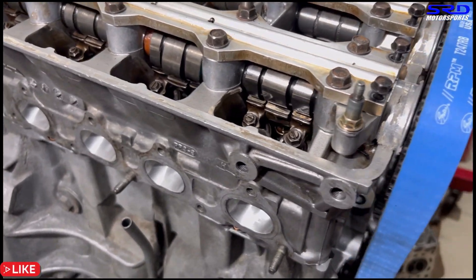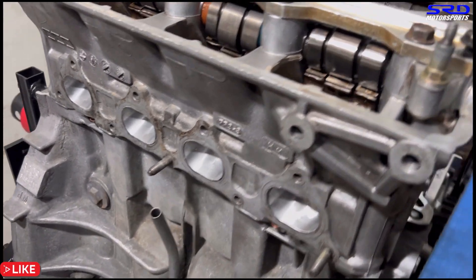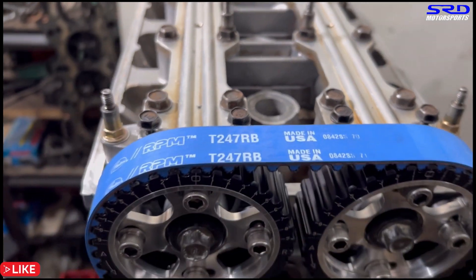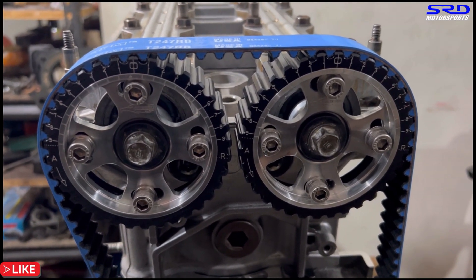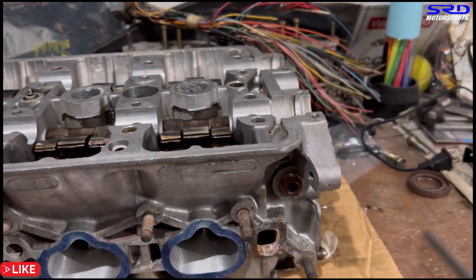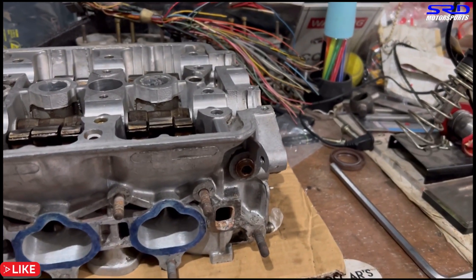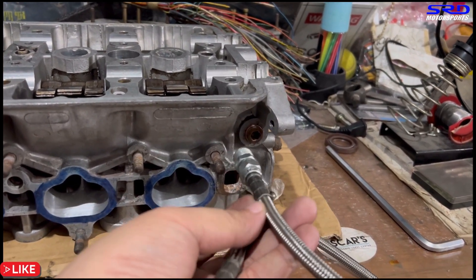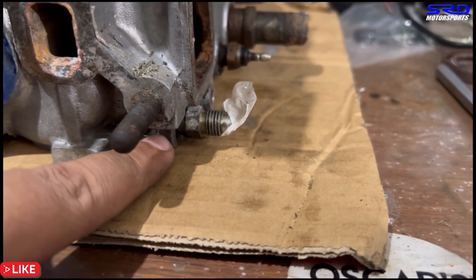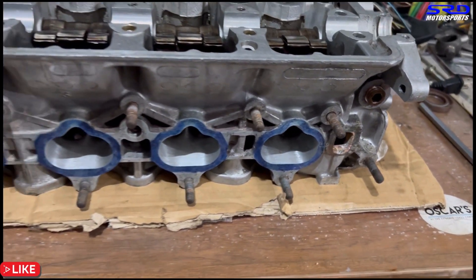Looking around the finished engine, the Crower 403 cam is up and snug with the Crower valve train, and the head is ported. The Golden Eagle cam gears — especially the silver one — look really clean. The old school VTEC line location on this engine always cracks when over-tightened, so we corrected it by running the fitting the way Golden Eagle and Speed Factory recommend — up top with a reducer fitting, not down at the old location. If it cracks, you risk an oil leak, running out of oil, and rod knock.